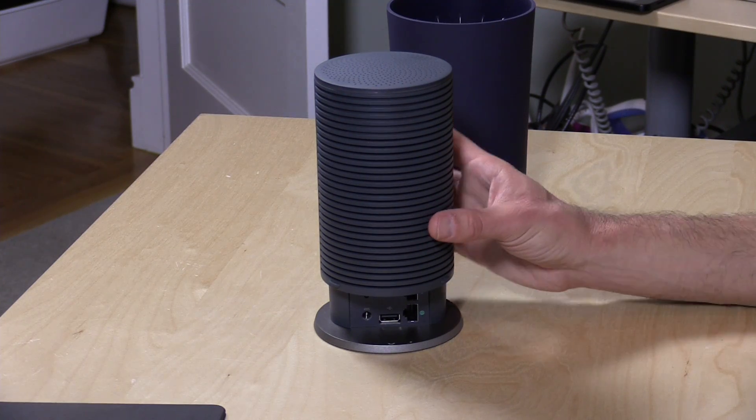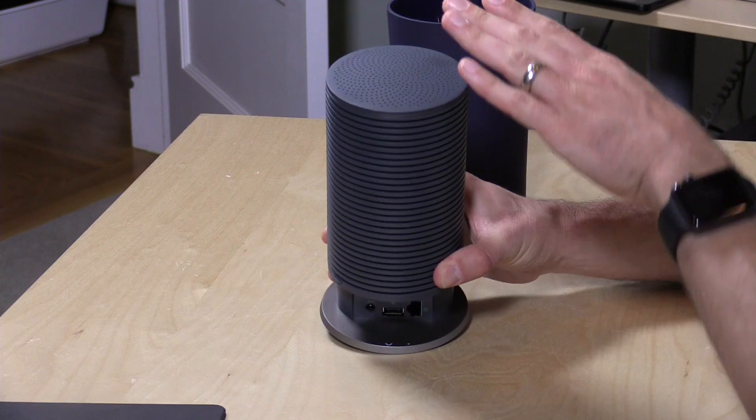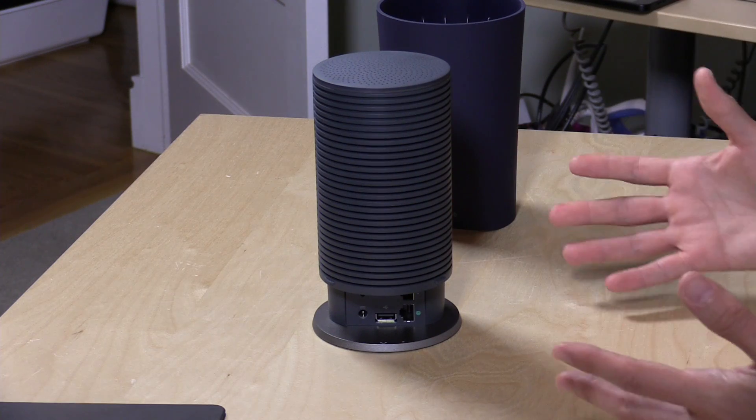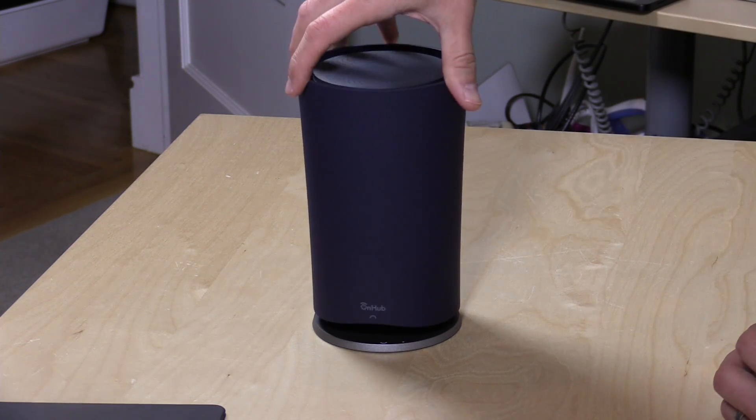In my tests around the house, I was seeing anywhere from 5 to 15 percent better signal strength than with my other router, so it did have a measurable impact in wireless range given those antennas and their placement. The 13th antenna is on the top and has its own dedicated radio for monitoring the environment — it looks for interference and automatically changes the frequencies the radios operate on to get the best possible signal strength. No channels to configure; it just sits in the background and constantly updates itself.